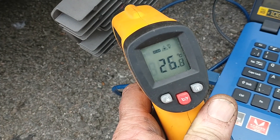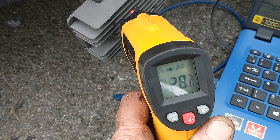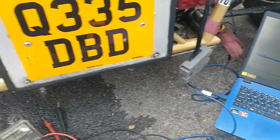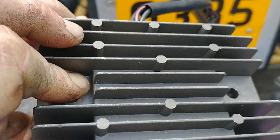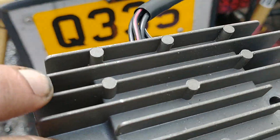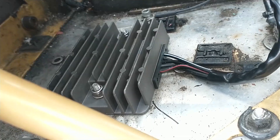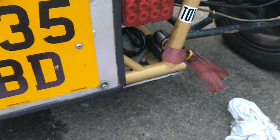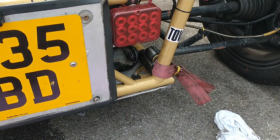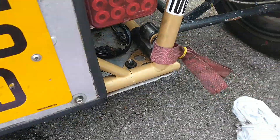See, that's ambient temperature. Running for a few minutes now, it's warmed up a bit, but nowhere near as much as the other one did. So I assume there's still either my bodges causing heat in that one, or some other failures in there. I think I am going to build a new one though and use this heat sink — most of the cost of these things is the heat sink, this big bit of metal. It's far more expensive than the electronics inside. New cheapy rectifier regulator fitted — I've just got a cable tie it down. And when connected to the battery it's giving a nice 13 and a half volts out. Fingers crossed. I think I should rebuild the other one, make it more robust. That will have to be added to the long list of stuff to do, which is getting a ridiculously long list now.